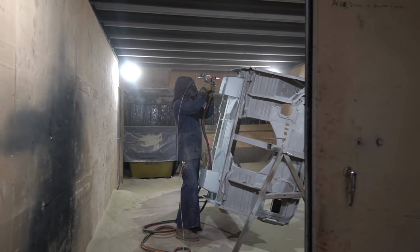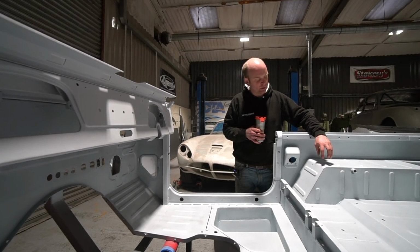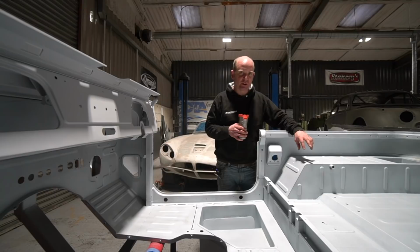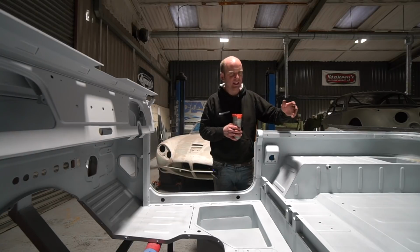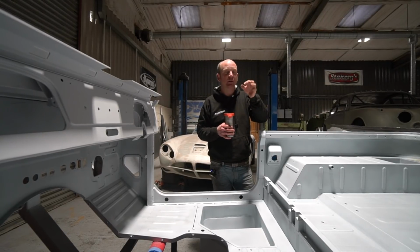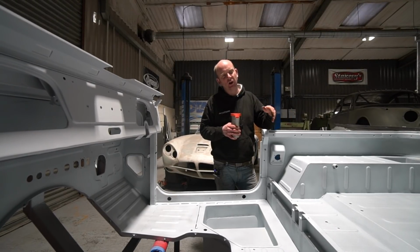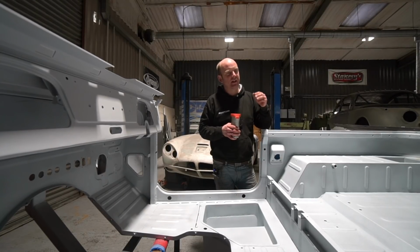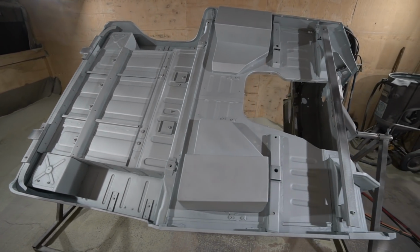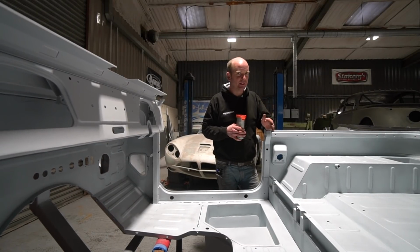We've had a salt spray test done on the final finish, which would be the zinc metal spray over blasted steel with an etch or epoxy primer. I think the salt spray test was actually done with an etch primer rather than an epoxy, and then U-Pol Raptor coating over that. We had those salt spray tested on a standard test, which is where there's a coupon, roughly that by that, which is then coated and then scribed back to the bare steel, and then it's put in the environmental test chamber, where it's subject to basically a hot salt water mist, and that sample underwent 3,000 hours in the accelerated test chamber, with zero red corrosion at the end of 3,000 hours. At that point we were advised there was no point testing further.